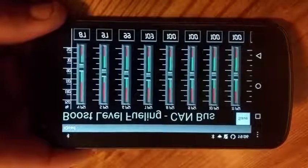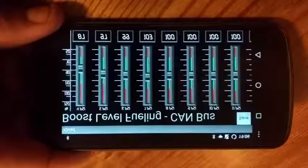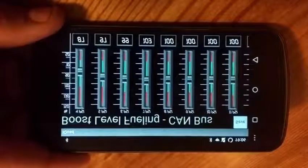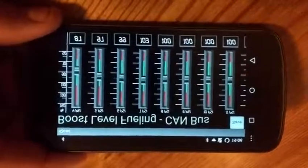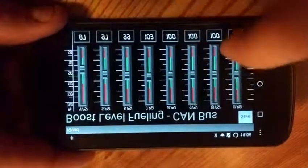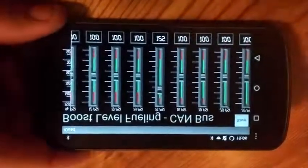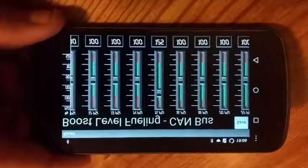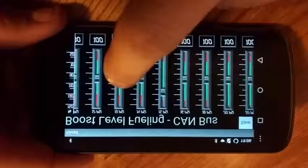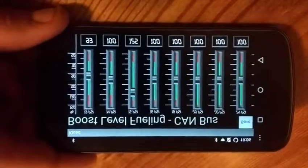There's 2 bytes in the fueling message that allows for the resolution of fueling. The maximum number you can get with 2 bytes is 4095. So like I said, OEM touches about 3600. So what that means is the percentage over stock that we can achieve is approximately 15%. So once you get up to higher revs, going over about 125 is not going to be any beneficial thing. You might want to go up higher or lower in the curve so you get more power beneath the curve, because OEM's not going to max out fueling until you get to about 20 psi, 18 psi.